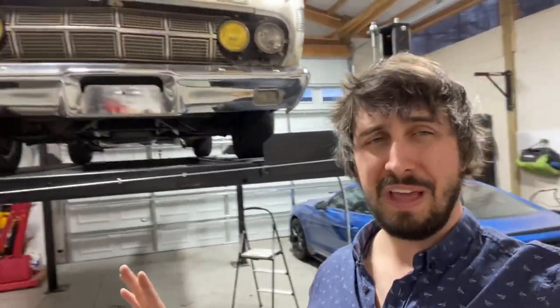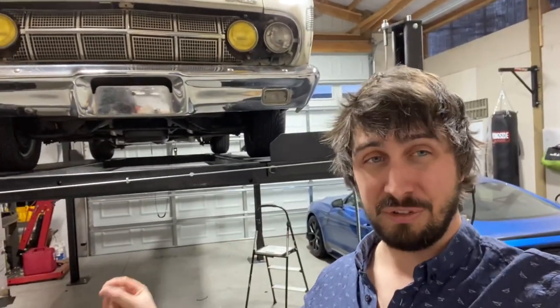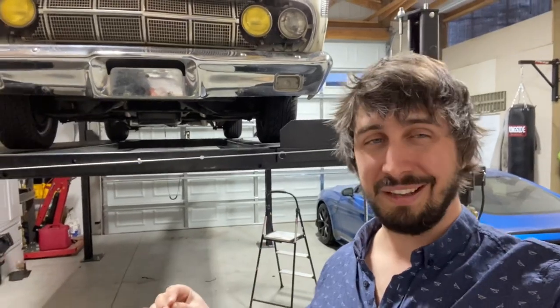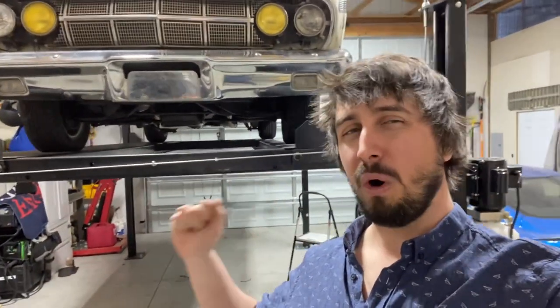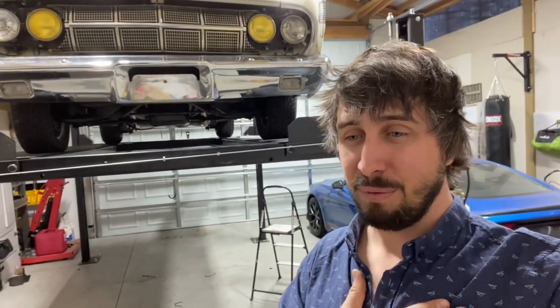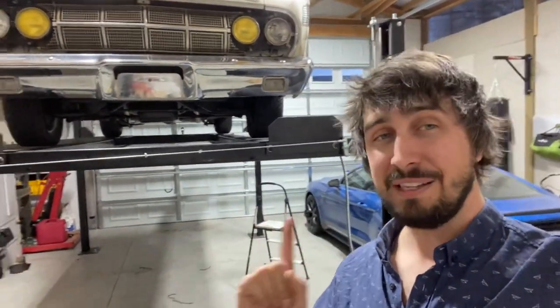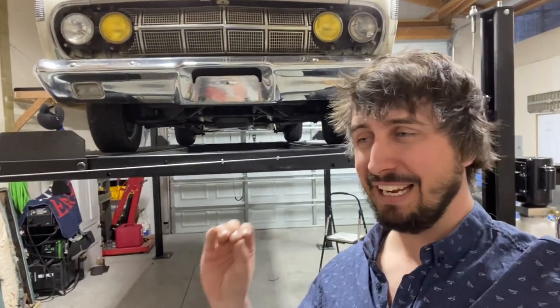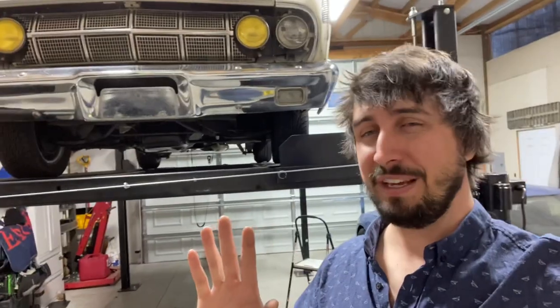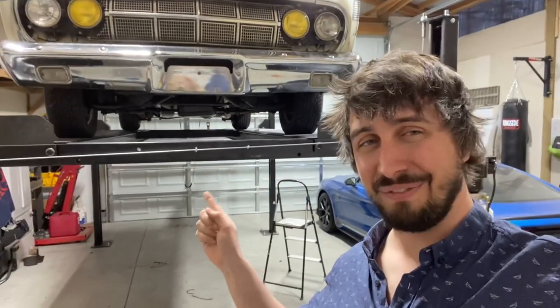As far as how it drives, this thing drives really really good. It takes a while to get set up — the bleeding process didn't go smoothly the first time. The big tip there: they say to open the bleed screw a half turn, but trust me, you want to open it more than that to get all the fluid out. But once you do all that and go drive it, this thing will drive honestly like a brand new car — somebody who's never driven stick before could learn on it. If you're used to a cable clutch like in a late-model Mustang, this is going to be a huge improvement. If you already have a z-bar setup, it doesn't interfere with your exhaust and it's fully adjusted correctly — I've had that on a T5 before and I think it's really good. Basically: if your z-bar is already set up and working, save the money. If you have a cable clutch, want extra space, or really want a soft pedal, this is definitely the way to go.